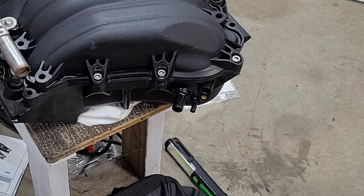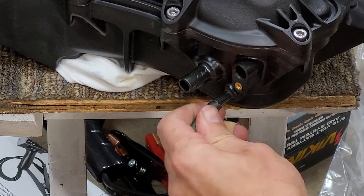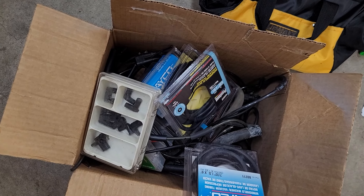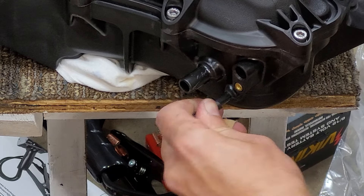The passenger-side rear manifold has a small vacuum port that we don't need to use, so to make a plug I used a short piece of vacuum line and a bolt with some RTV on it — it just slides fairly tightly onto the port. It also helps to accumulate over time various vacuum lines, connectors, and fittings for occasions like this.